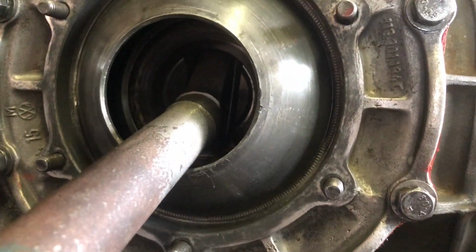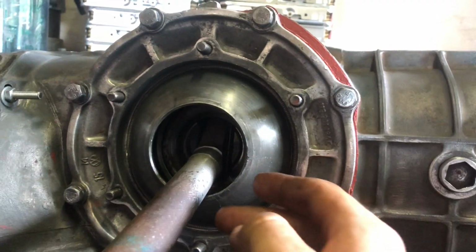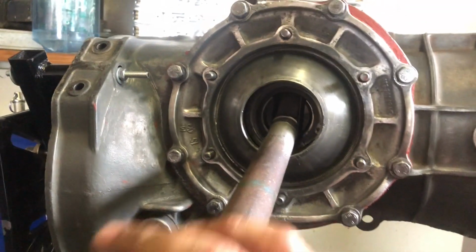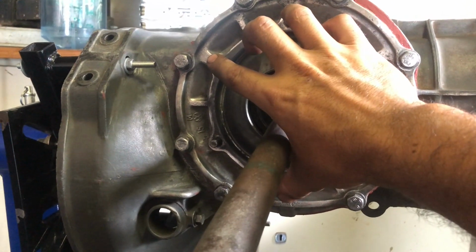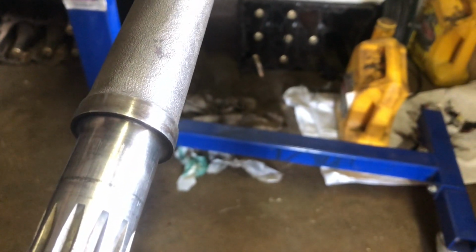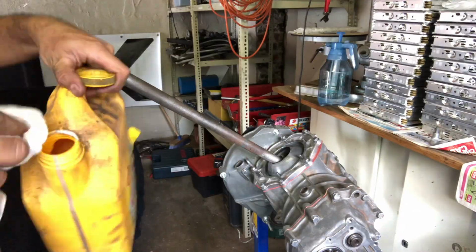Okay, so now I need to make sure that I don't pull the shaft back out, so those little half round goodies don't fall back in, because otherwise I have to take that circlip off again. So what I'm going to do is put the sleeve over here and then tighten those bolts up. Oh, and I've just been cleaning these spacers and bearing for the end of the shaft, so that should all tighten up quite nicely and keep that side together. Then we can start working on the second side, which will be most excellent, because then this damn thing will be together.